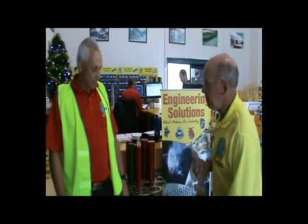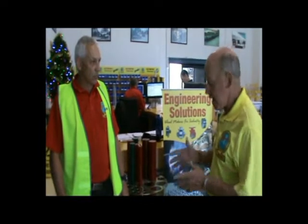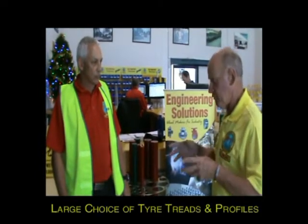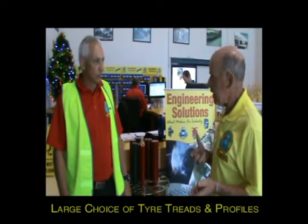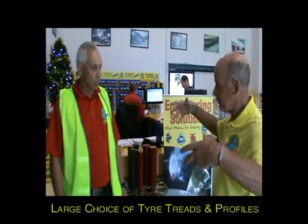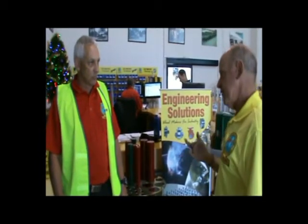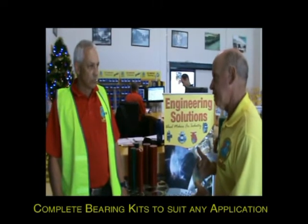Got to be a plastic core and got to have precision bearings. The wheels we've got now — we know the rubber's good, we know the plastic on the inside is good so the wheels don't burst if they're overloaded. And we do precision bearings in that wheel now, because at the speeds land yachts work at, you're going to have precision bearings.